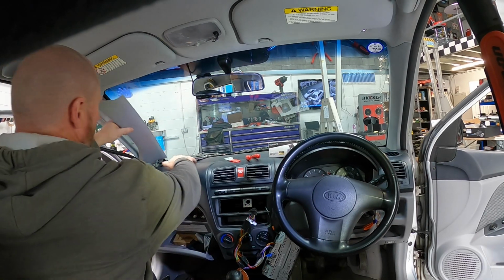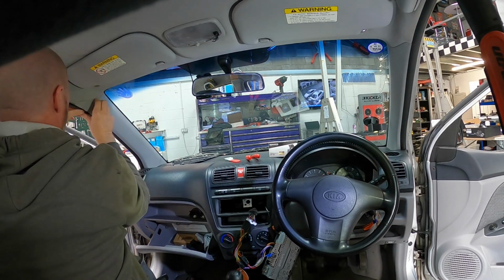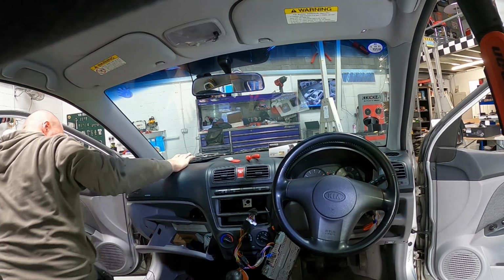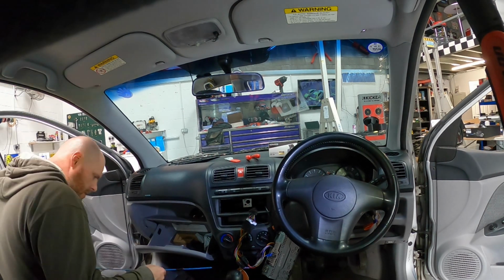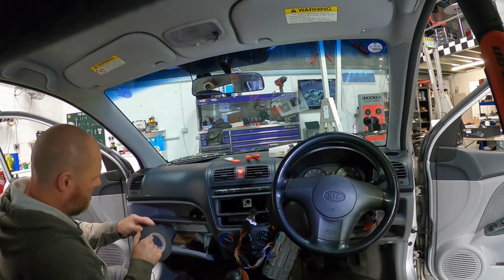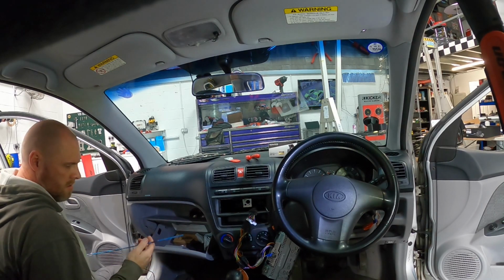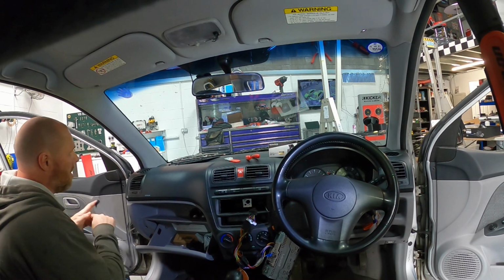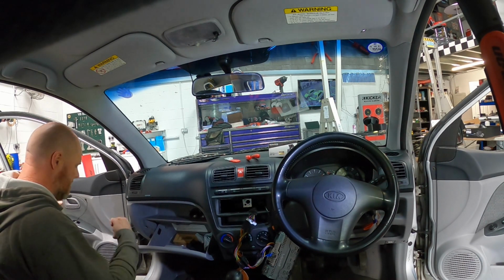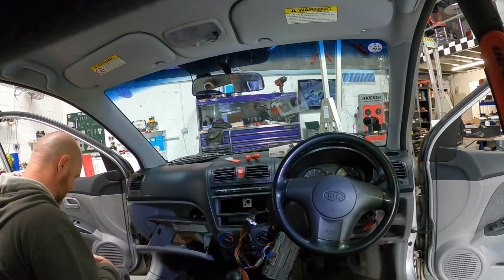Back in with our A-pillar trim. Back in with our rubber. I like to use these cable passes. They're just nylon rods like you'd use for poking chimneys and things like that. But they're nice and simple. Just pass through behind the dash without causing an issue. Obviously common sense says don't use a metal coat hanger because you can't see where the thing is going, and the last thing you want to do is stab it into a live wire or something, or nick something.